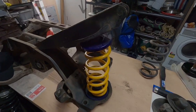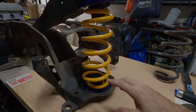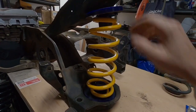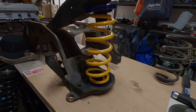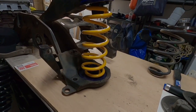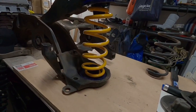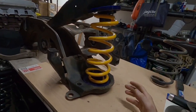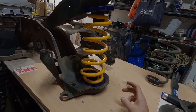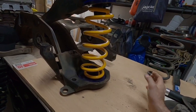What I'd call basic lift - which doesn't need a lot of other parts - is a raised spring and Super Pro top and bottom. That gives you about 35 mil of actual suspension lift, and with that you don't really need extended brake lines, extended shocks, or camber arms. Your camber might need an offset bush or adjustment to fix it.